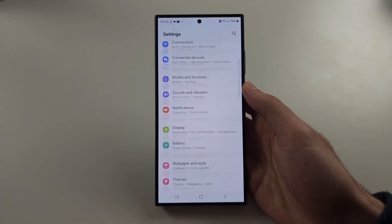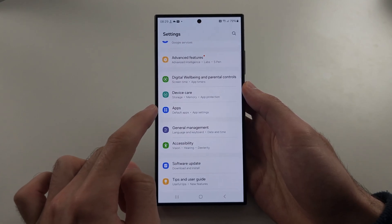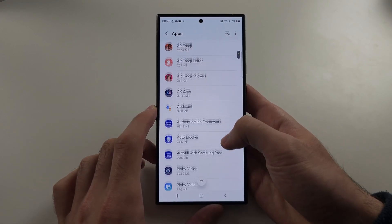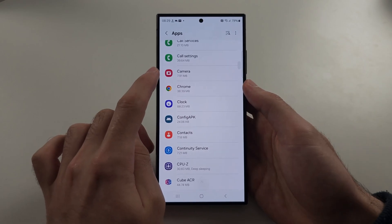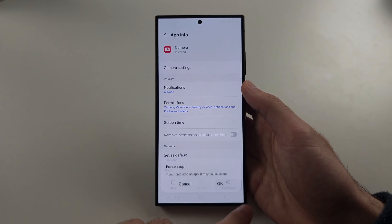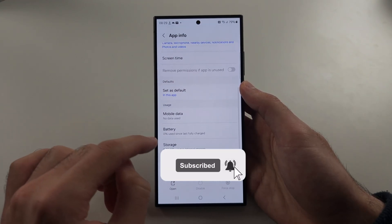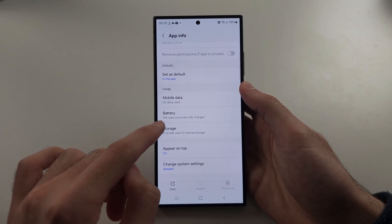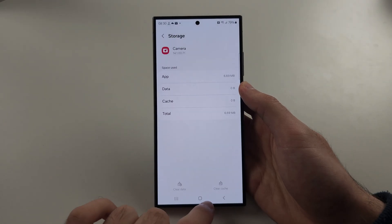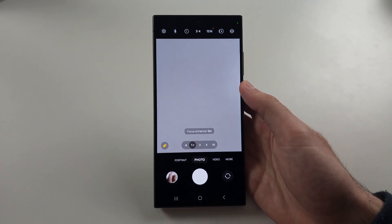The second solution is from the homepage settings — scroll all the way down, and then select where it says Apps. We're going to locate the camera and tap the default camera app, and we're first going to select Force Stop. Then scroll down and select Storage, tap on Storage, select Clear Data and delete. This will not delete any photos. Now open the camera app, try again — hopefully this now works.